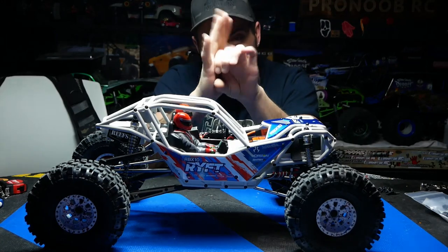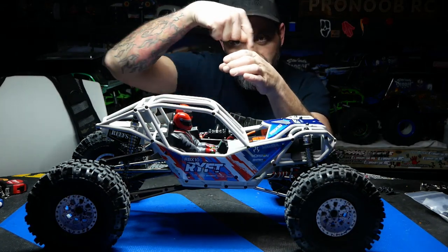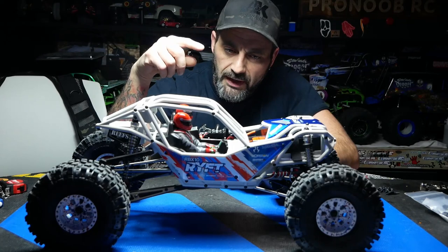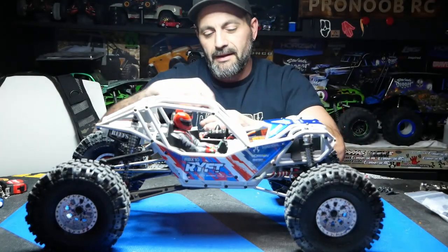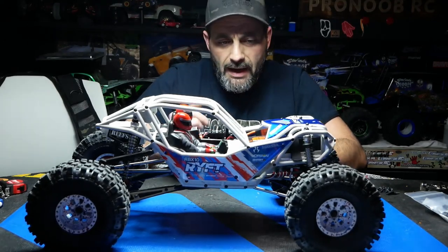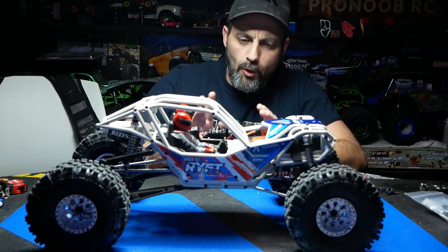Another thing is the seating of the diff cup. If it's out just a little bit, it's going to be horrible on these differentials. The edge of the diff cup where it comes up — we trimmed the edge with a knife so it sat nicely, because it cups inside the teeth of the bevel gear. You can actually see on the seal there is a mark left when it's against the bevel gear. If it's giving you trouble, take it apart and make sure you see that little cut line from the molded seal in the plastic all the way evenly around. When we were first tightening it up, it was only touching on one half and we were running into binding issues. We had to tap it down, tighten the screws on the bench with needle nose pliers, tap tap tap, tighten the screws until you couldn't tighten them anymore. We put it in and got the diffs working good.